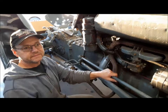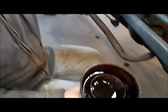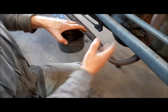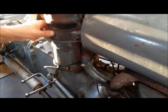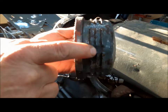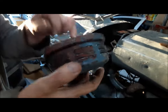These things have an oil bath air cleaner, and that doesn't look like it's been serviced in a long time — there's a lot of crud in it. What also happens is it's got steel wool packing up in here that can get plugged up with crap over time. Under this cap there's a little inlet screen, and you can see that is all packed with junk. We'll get this all cleaned up — I'm not saying that's the problem, but it's not helping.